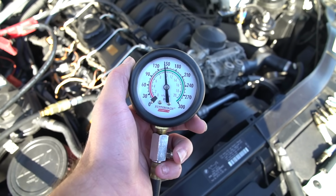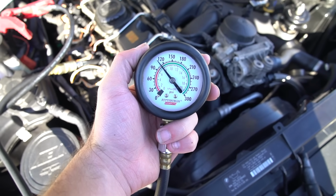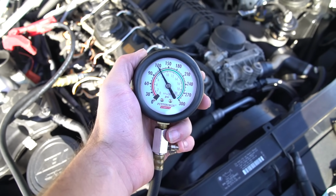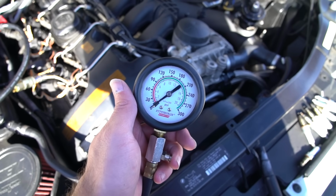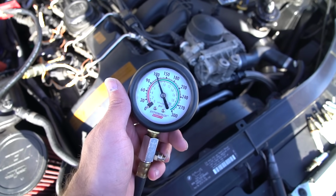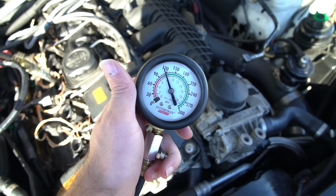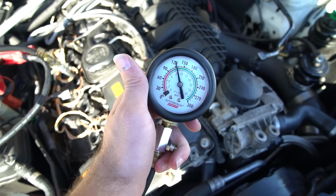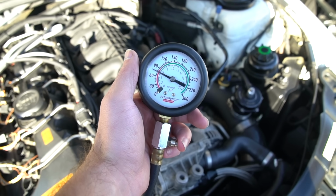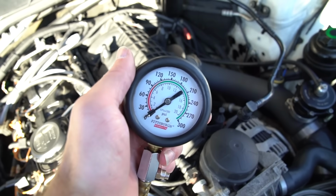It was still going up, but like 145. All right, cylinder number 12, hit it. 120. Really? Yep. Another one's 145? Yep. Well, that's not good. You can go one more time. Yeah, 120. All right, go for it. Like 123, 125. All right, go for it. 120. All right, number 5, go for it.